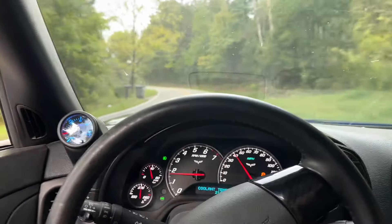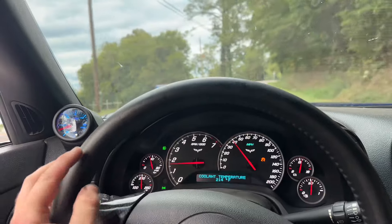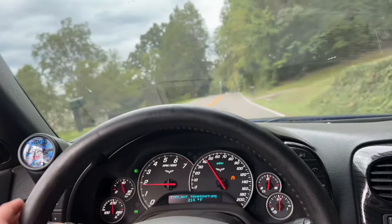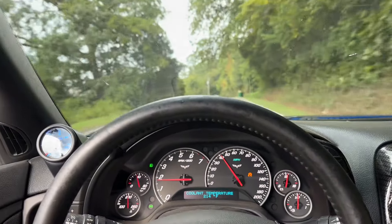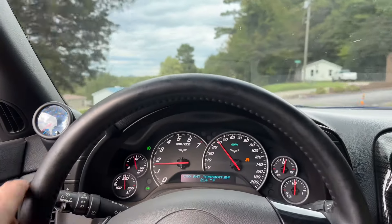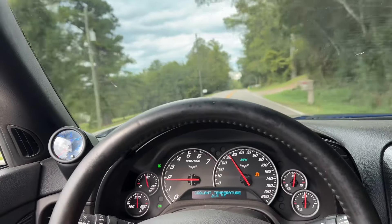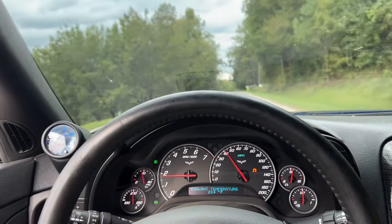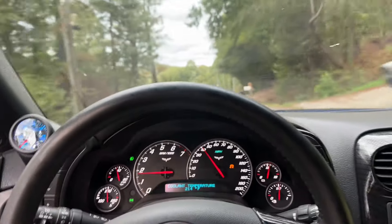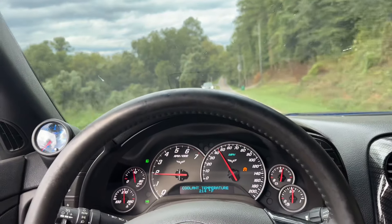When I put it all back on, I did not tighten up the supercharger belt tight enough — I thought I did, I just kind of cinched down on it with some wrenches. Well, the car was only making like 4 to 4.5 pounds of boost, barely peaking 5, and then it would just start falling off in the higher RPM. So I tightened the belt up and this thing is making like 6.5 to 7 pounds of boost. You'd be surprised what 2 to almost 3 extra pounds of boost does — this thing feels like a completely different car. I'm on my radials right now, 315/35 Mickey Thompson ET Street R's.